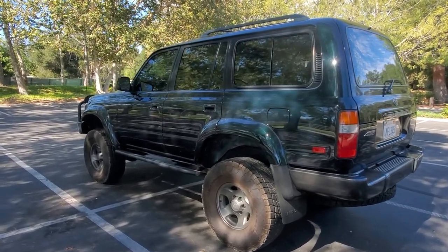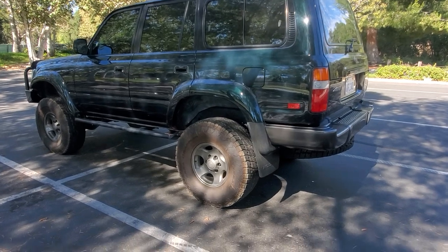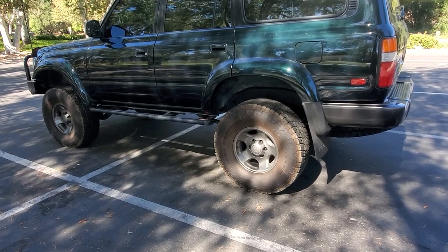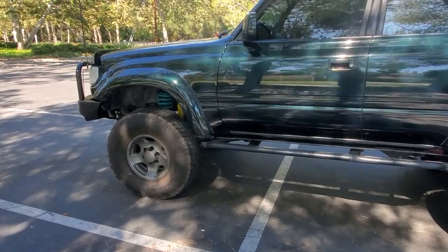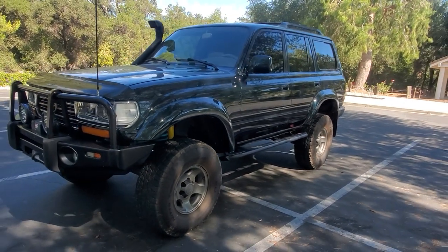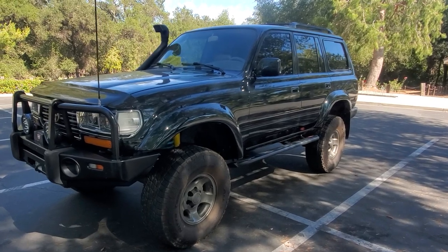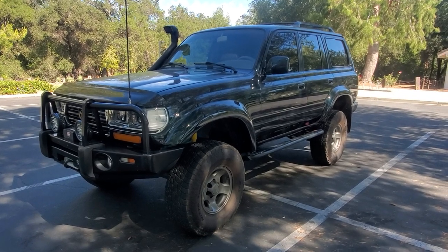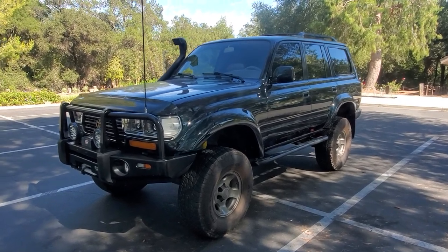The price was at $36,000, but I took off that rear bumper and put on an original, and I removed the shocks that were on it. Yes, it had King shocks, but those King shocks were meant for a three-to-five-inch lift, so it wasn't really benefiting from them. These now have Dobinson shocks for a six-inch lift, and it rides so much better. You can take corners at speed and it just holds — like riding on rails. As lifted as it is, it drives incredibly well.